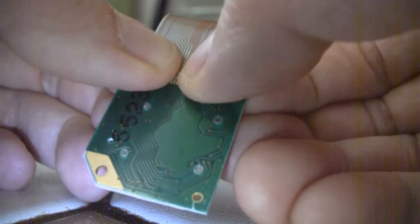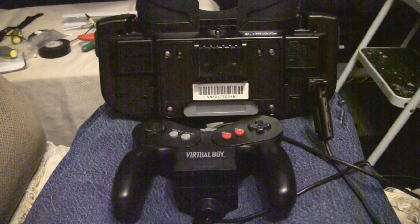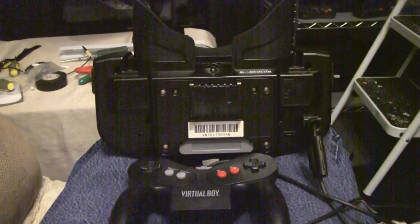I'm going to pop this thing back in and see if it worked. I've tested it, and guess what — it functions 100% normally now. Let's take a look. There's the right side, the scan lines are gone, the glitches are gone. The left side functions as well, no glitches. I'm going to continue to test and start playing this system more often. I know what to do in the future now. If you have the same issue, I suggest you go straight to the oven technique and not use the heat gun. I believe the oven spreads the heat a lot more evenly. Thanks for watching.